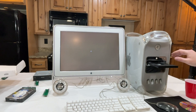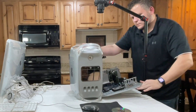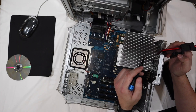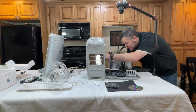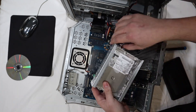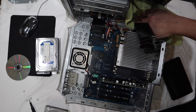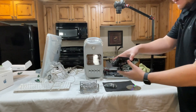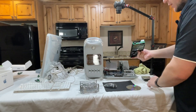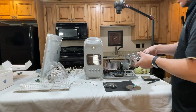After all of that, I think we have a bad hard drive, so I'm going to swap that out real quick. In order to remove this drive, you have to remove this screw right here first. Give it a quick wipe out and we'll put our replacement drive in. I already have the IDE to SATA adapter — you don't need a master switch. I'll put an Amazon link below; I use these on just about every single upgrade I do.